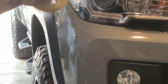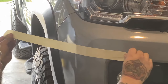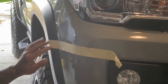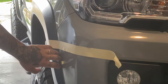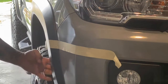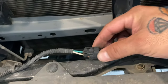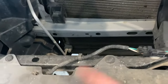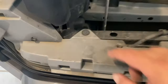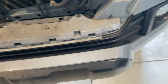Run your masking tape straight across those lines, making sure it's even. Once you lay that on there, this is where you're going to make your cut on the fender flare, and then you'll pop that off to do some cutting. To take down the bumper, you need to detach this clip — it is your fog light harness. You'll have a total of six of these clips that you pull up with your screwdriver to detach the bumper.